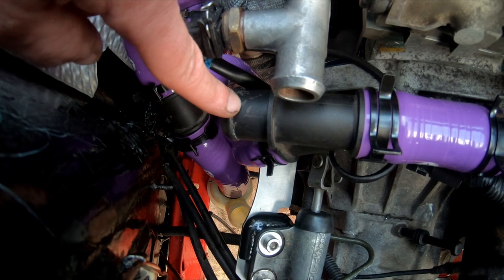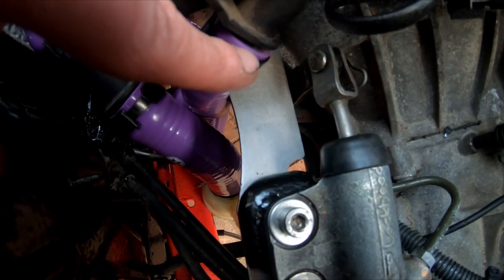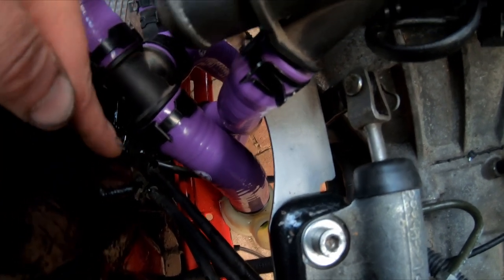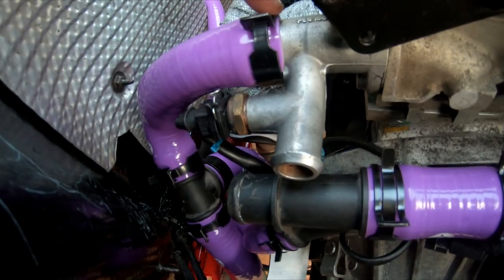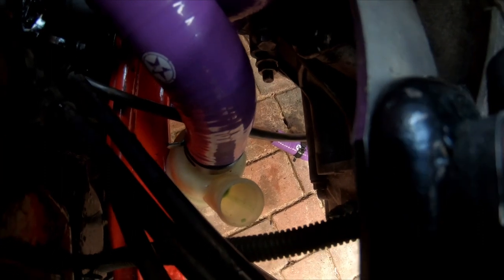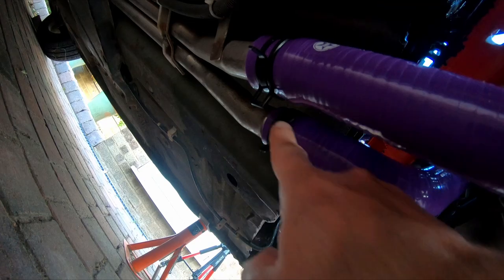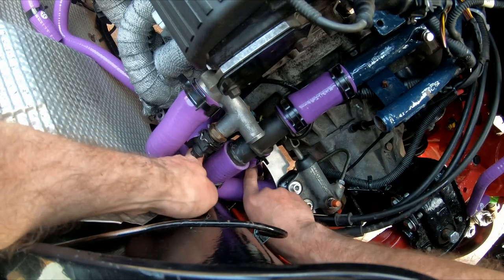This is obviously the return pipe that I've temporarily removed. The heater pipe from the Y connector goes down between those two hoses on the T-piece. The coolant output is plumbed to the top of the T-piece. The bottom of the T-piece goes down to the PRT. I think hopefully you can just see it. The side of the T-piece that goes down to this pipe from the radiator. I can now replace that return hose that I removed.